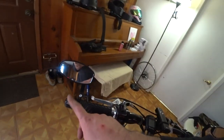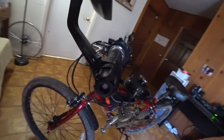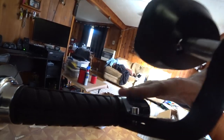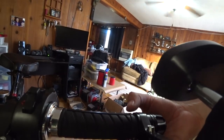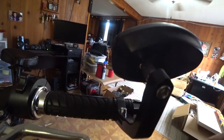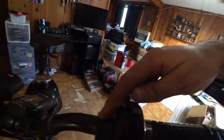But my conditions here are pretty extreme and it rains a lot, so I wanted to shore that up a little bit more. The bar and blinkers with mirror assembly, here's how they're mounted to the bike. It's pretty simple and self-explanatory. They have a rubber bushing that goes into the bar, and as you tighten the two nuts together, it expands, clamps against the inside of the bars, and well, I'm pretty sure you guys know how that works. But it's got a hollow bolt that goes through, allows me to run the wires through the handlebars